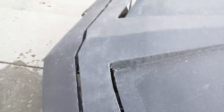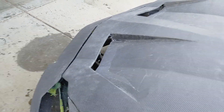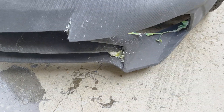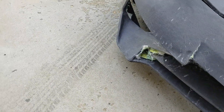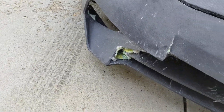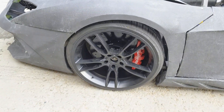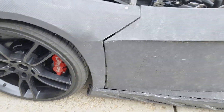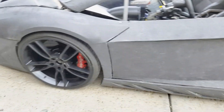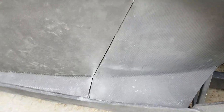I've had some questions about the vents in the front — they're actually for the AC condenser. They turned out pretty nice and I think they'll allow for a lot of airflow. We also need to remove some of the bagging material on the front fascia which obviously hasn't been completely removed yet. The doors are looking pretty good, opening nicely, not rubbing. We have a little more gapping to do, and on the driver's side there is some warpage that we have to take care of.